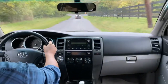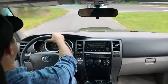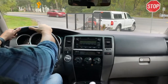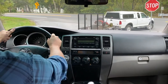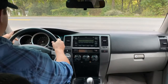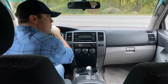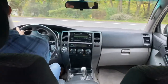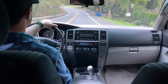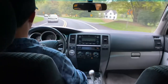The only thing that I can see is the tire light is on, but it's solid. So usually that's an indication that one of the tires is just low on air. So I'll double check that. And we have a service station, so we can check the tire sensors. But usually, if the light is solid, then it's just one of the tires is low. But the other thing it could be is a sensor. But most of the time, if it's a sensor, then it's flashing. So I think it's just one tire must be low in there.